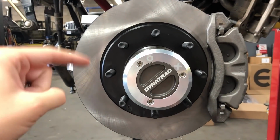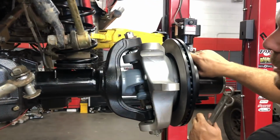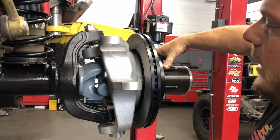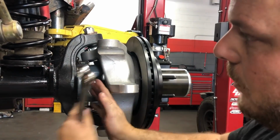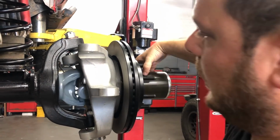So, at the moment, right this second. So here, let me show you. So right now we're locked. Come over here to the U-joint. So we're driving along, we're locked, we're spinning, and then snap, somehow we break something here. I can come over here and unlock it, and now look. See, it disconnects the wheel hub bearings unit from the rest of the system. So then I'll lock it back in again, and there you go. And now you're locked back in.